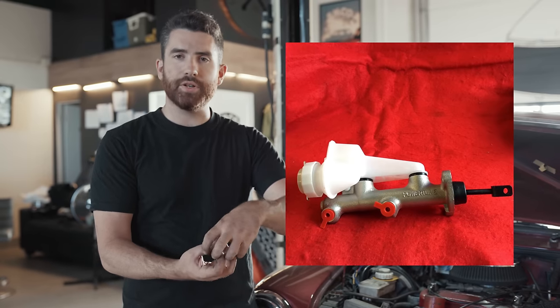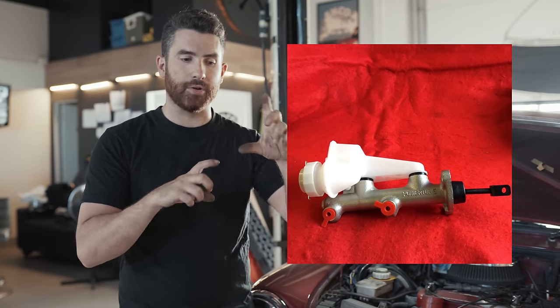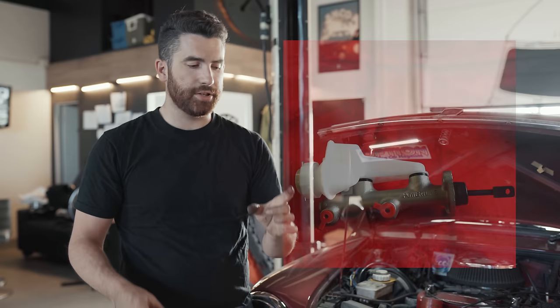And that brings us on to the second type of master cylinder. That's called the yellow tag conventional master cylinder. Usually those were vertically mounted master cylinders, and they are twin bore. There's actually a 0.70 inch bore and a 0.75 inch bore, but they run on the same piston, and one feeds the front brake, the other feeds the back brake.